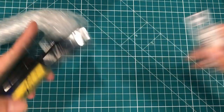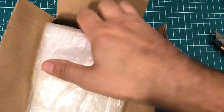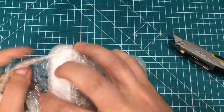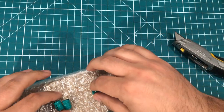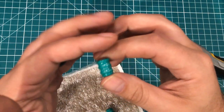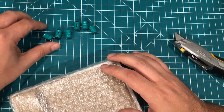Those are my cards and I've got some learning to do. I think we're near the end — this is the last one and I absolutely have no idea what it is. These are the little 3.6 to 3.7 volt nickel metal hydride batteries. If you've ever looked at any of the old computers, a lot of them have these barrel-style batteries, and a lot of them have batteries that tend to leak and just destroy motherboards. Motherboards from the 286 through Socket 7 — the early Pentium-type stuff — are being destroyed at an amazing rate by these batteries leaking.